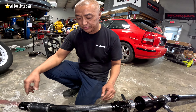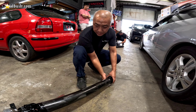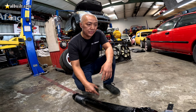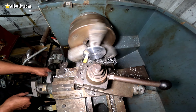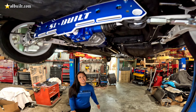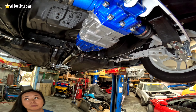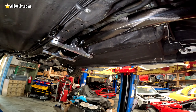What we have here is the jackshaft we've been trying to get made for us — finally got it done. These are all aluminum. The inserts are aluminum and then this is carbon fiber — it's actually a Honda part number. We're using a 30k viscous and then our billet carrier bearing. This side here is carbon fiber and then this one here is the slip. This aluminum portion is pretty thick but super light — this thing is 1310 size, same as a standard 1310. The heaviest part is the viscous cup, but this tubing is like less than a pound literally. We're going to test it out and see how well it works.